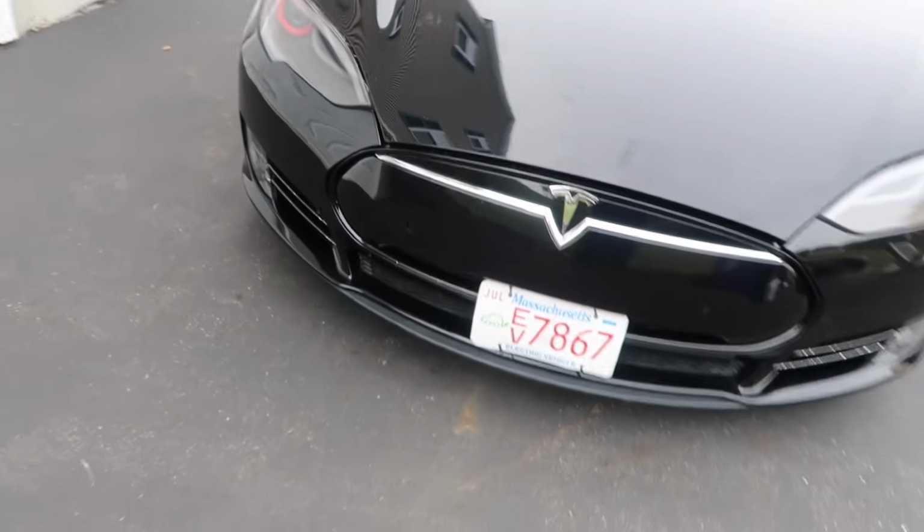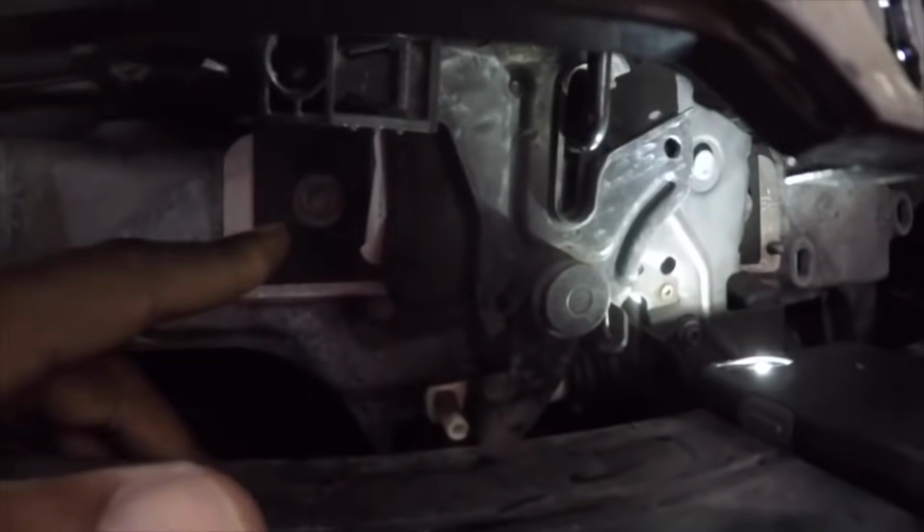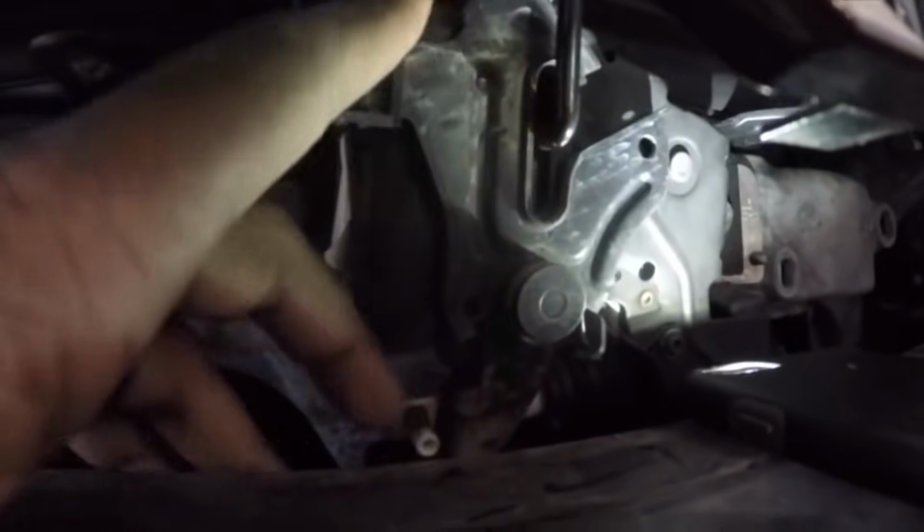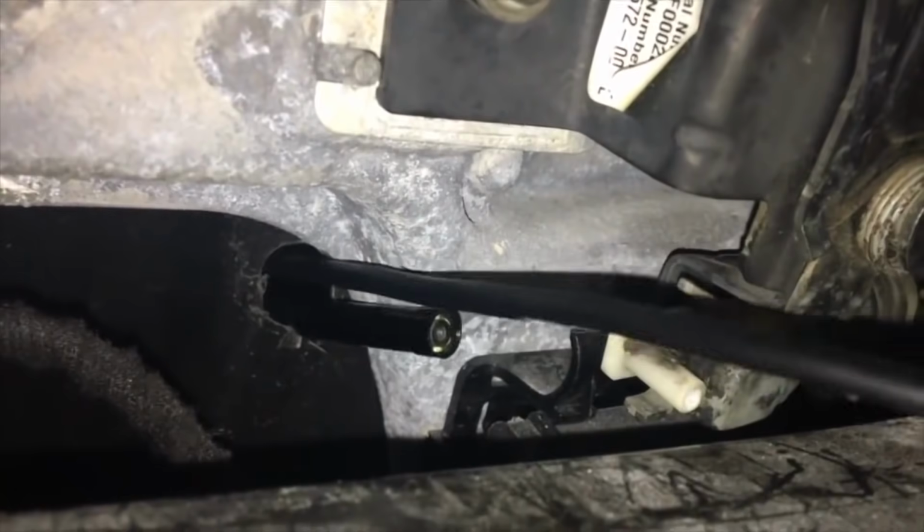If you're a long-time subscriber, you remember the time I locked my frunk with a dead battery and also managed to disconnect the hood emergency lever underneath the dashboard and disconnect all electrical connections going to said release lever, effectively screwing myself. Well, to fix it, I had to take the nose cone off the car, drill a small hole, and use an inspection camera to fish a hanger through the frunk tub and unlatch the hood that way. Well, thankfully I still have that workaround in place to get into the frunk.